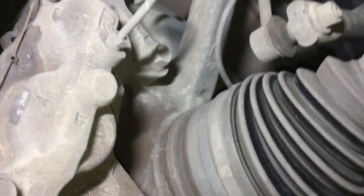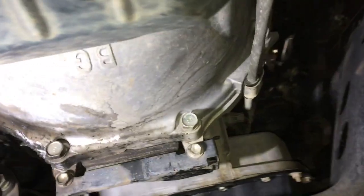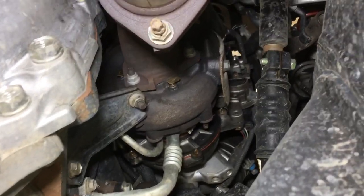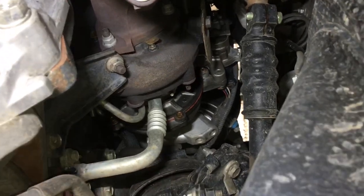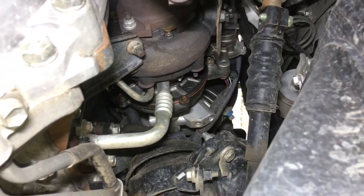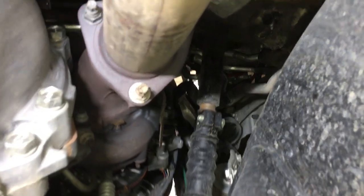A little bit of oil on the front diff — again, that'll be part of that job. Drive shafts, boots, ball joints — on a visual, everything's good. By kilometres, should probably replace those front wheel bearing assemblies. Turbo — bone dry. I mean it's even got a kind of sweat on it but in my opinion that's bone dry. Engine mounts look good, no need to change those.